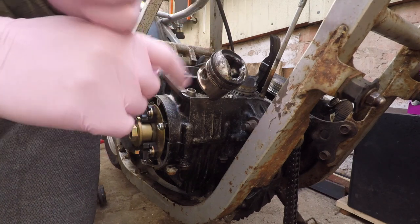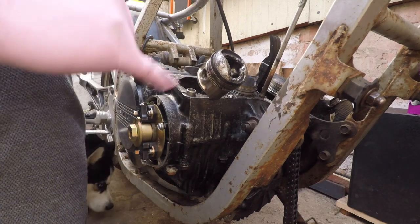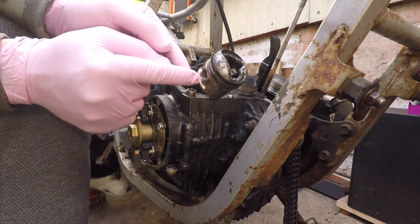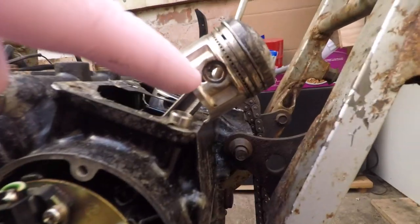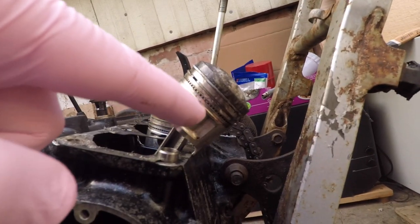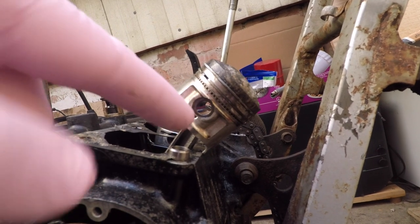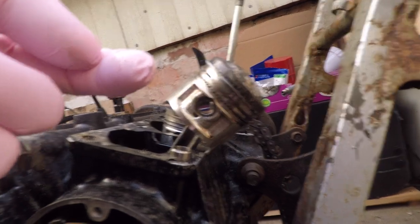There's five rings on this piston and it's got a safety circle pin here, in here, next to this shaft. Next to this shaft there's a circle clip — you have to kind of take that inward and remove it. So I'm gonna put the camera closer.